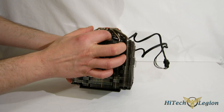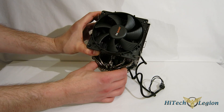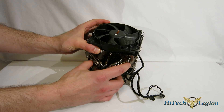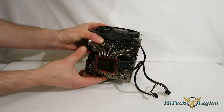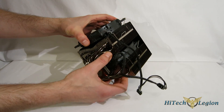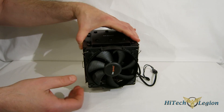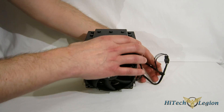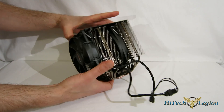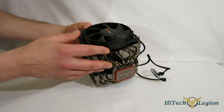It's not a tremendous amount — you're not going to say it went down 10 degrees because of this — but it will knock down temperatures a degree or two just by adding more dissipation to the block. Less heat needs to go through the heat pipes, so you get better all-around cooling. Be Quiet also has dimpled fins. They do a beautiful job in their construction, and it's no exception on the Dark Rock Pro 3. Beautiful solder, everything comes together perfectly. When you pick up a Be Quiet product, you're seeing a really high quality product, evident in looking at it, feeling it, and the way it comes packaged. All black all the way around, the heat pipes are a dark nickel — a great look inside the case.